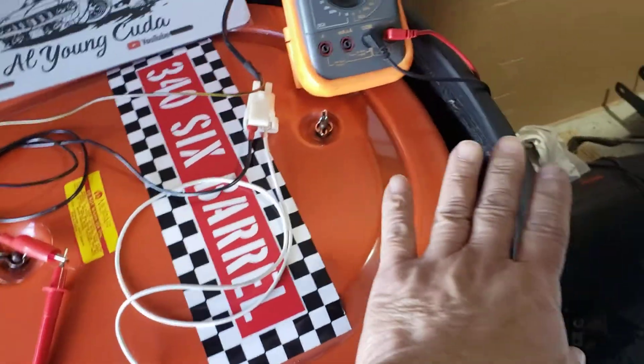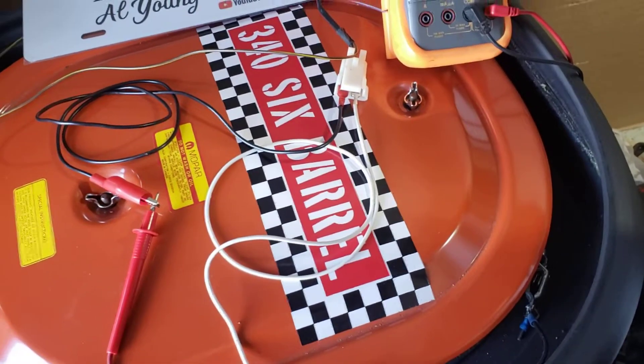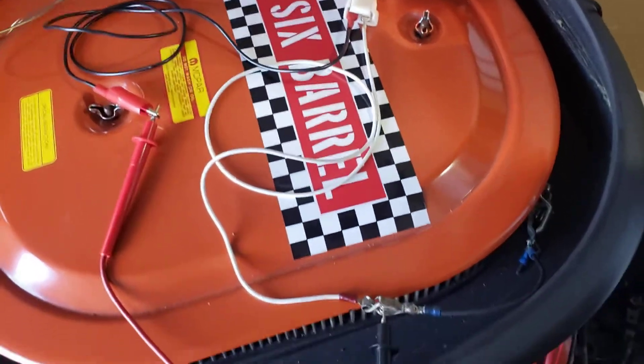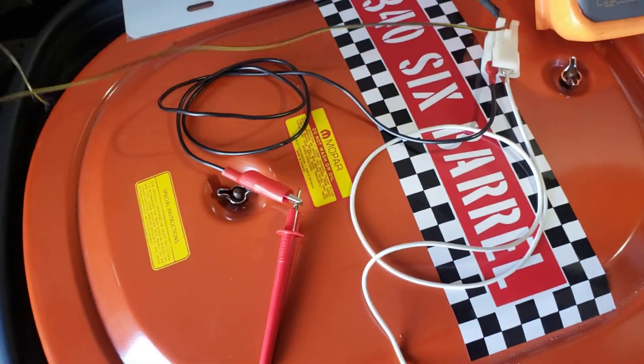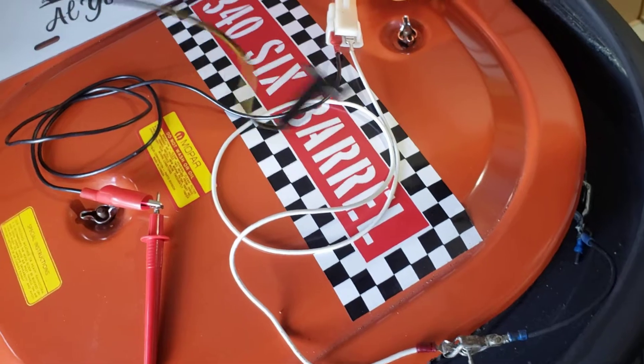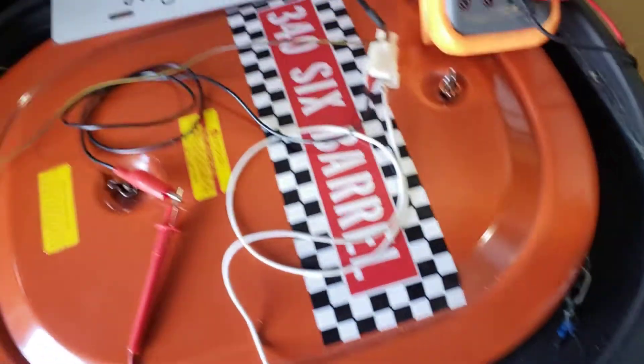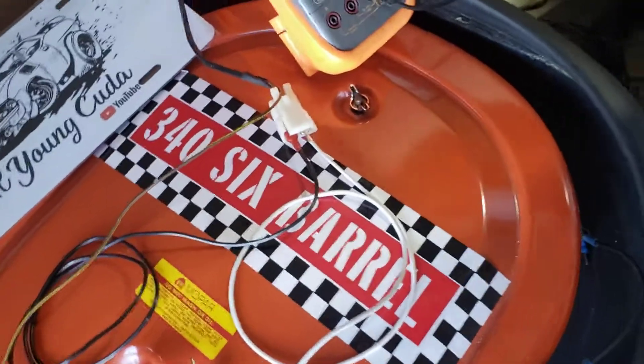As long as that's all good, the circuit from down here to here is perfect. So now you just have to check on your bulkhead towards the back. Don't forget — this is the wire that goes to your relay; it's a ground only in park and neutral, so it starts. That's it. Enough of my fugazi wiring. Ciao.